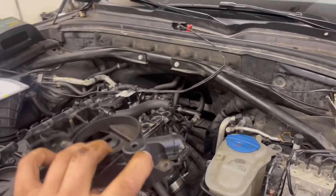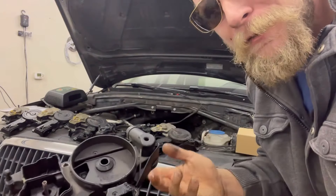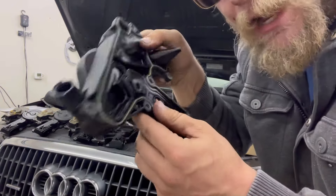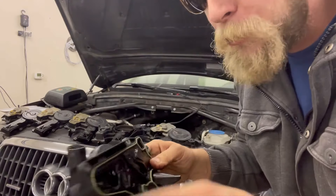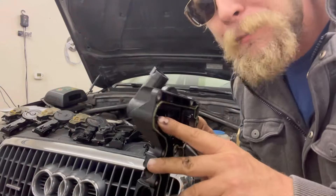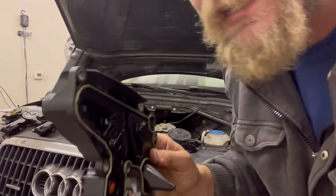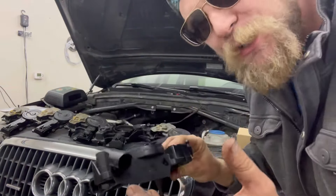Let me demonstrate. You might not want to suck on your breather like I'm doing, but whatever. I'm going to try this cut-open one first. First we're going to suck on it — it pulls nicely, you can hear it coming through here. Now I'm going to blow on it and see if that flap is working properly. You hear that? Some air is still coming through here.